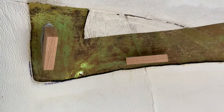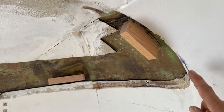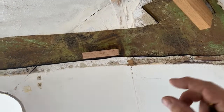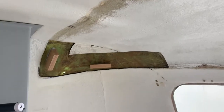We're going to fiberglass these all in place so that when we go to put the cabinet back in, the cabinet is just going to bolt to these blocks with some nuts and bolts with little rubber washers — so there's going to be no vibrations. I also ordered some new RV edging: one-eighth inch by nine-sixteenths, white stuff I found online, and it's on its way.